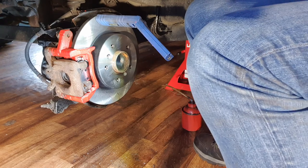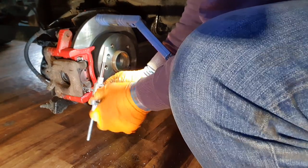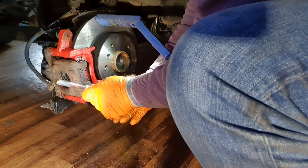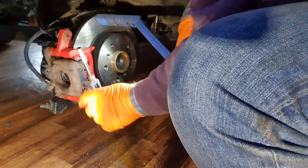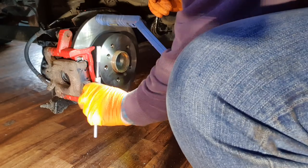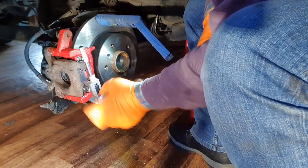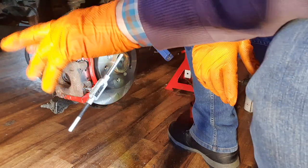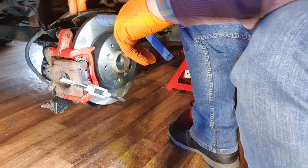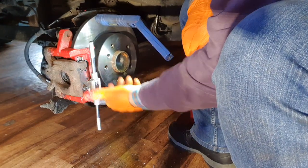Tap it out now. And as I said, M6 is what I'm using. Here we go. Bit of lubrication. Drill bits, if you keep lubricating the drill bit, it'll never go blunt. Actually, self-sharpening. It's different if you're drilling a hole in tin, but drilling insert holes like this, lubrication is vital.